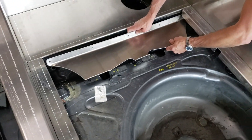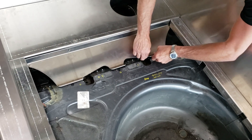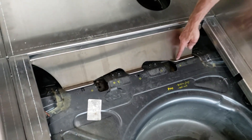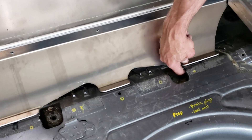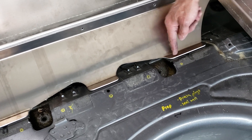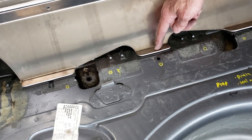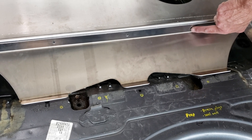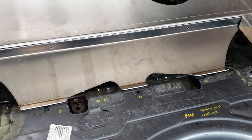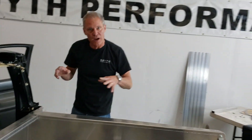You stick it under one side and come up on the other — these holes line up. Then you're going to rivet or bolt. I choose to bolt right here and right here, and then rivet and bond the other places. You could technically reach in here with a bolt, but put a couple of rivets here, a couple of rivets on the outside, a bolt here, a bolt here, and then obviously you're going to put the bolts through these holes into the tray. Then you're really starting the process of tightening down all of the bolts around the bed.